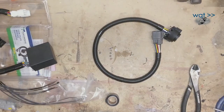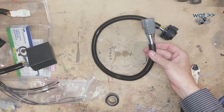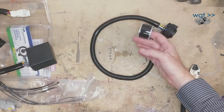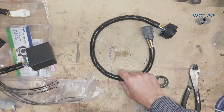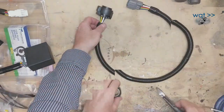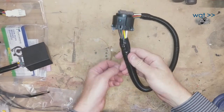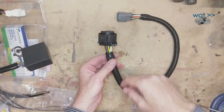An optional step I like to do — since electrical tape wrap can be unreliable, especially when exposed to heat or elements — is use a little bit of silicone tape and overwrap that. Something to be aware of is that over time the self-adhering silicone tape tends to become hard and brittle, but usually it won't unwind.